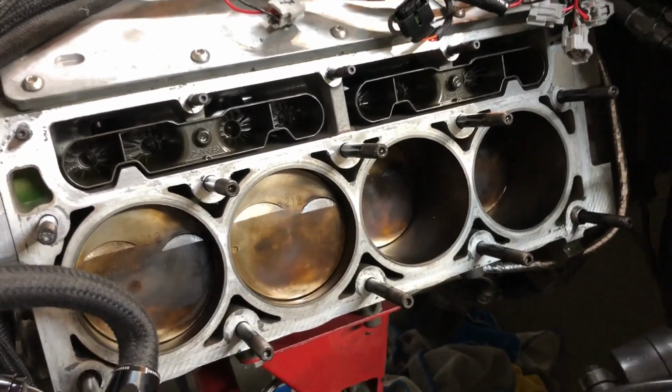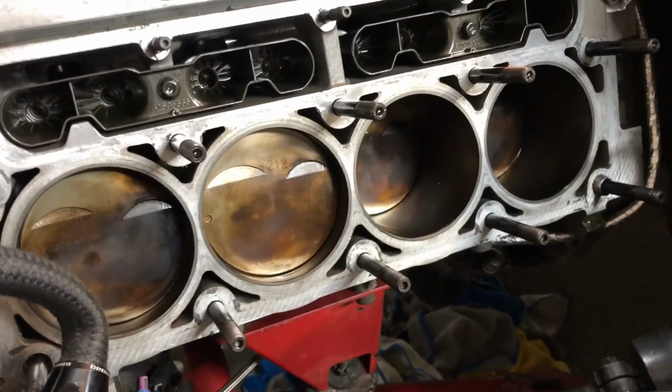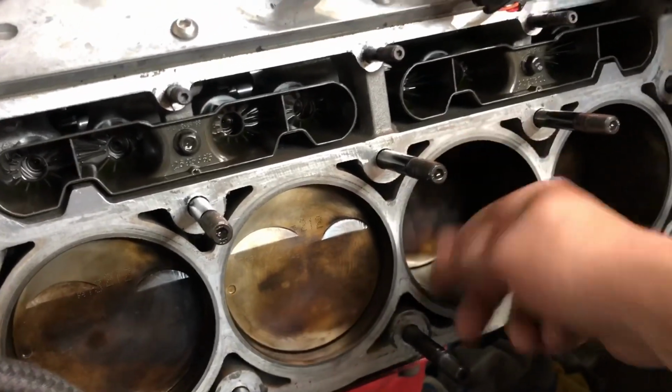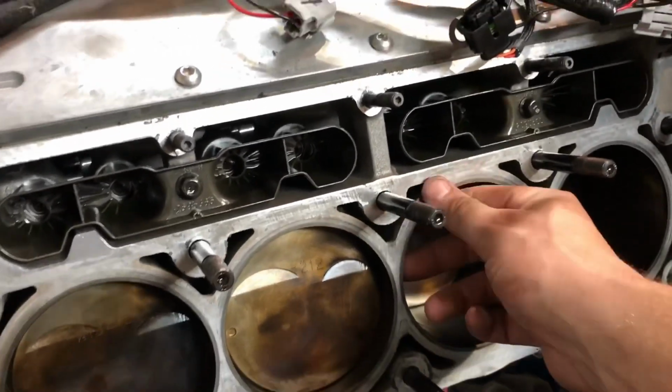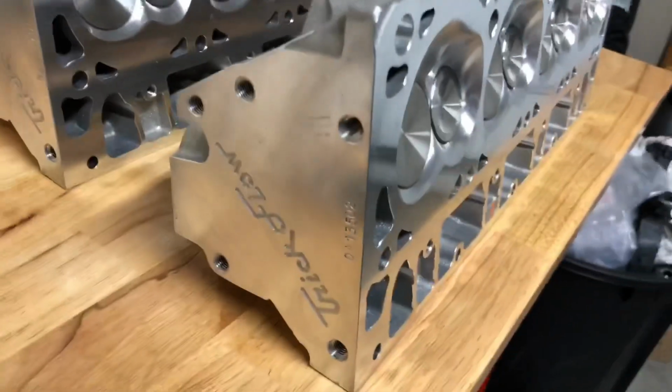If you have head bolts, then you have nothing to worry about. You have no studs to pull out, so you can just go to town. Be careful with the razor blade. Don't let it dig into the side of the aluminum or anywhere on the deck surface. You don't want it to knurl up or leave any high or low spots for that head to bolt down to.